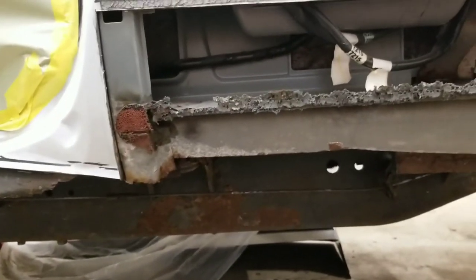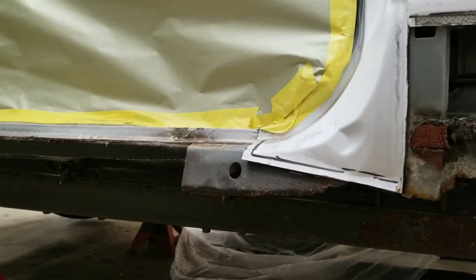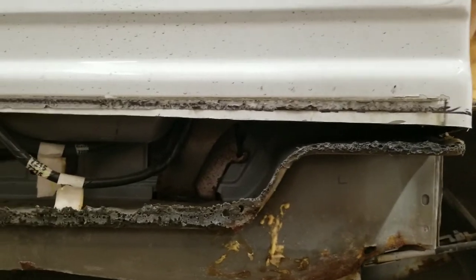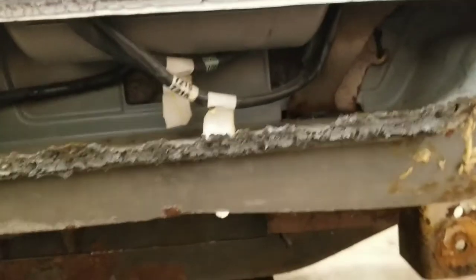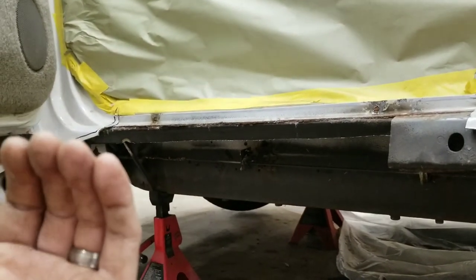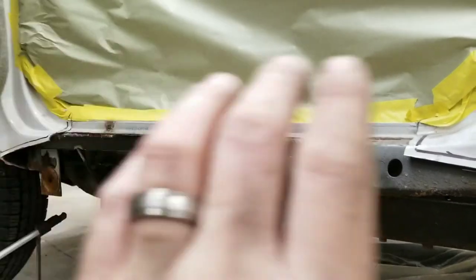The next video, we will prep it all, grind it all, and go ahead and hopefully start welding the panels in. And what we'll do is we'll weld these panels in, and then we'll go back on the inside then and finish our inner rocker once we get the outside pieces in.